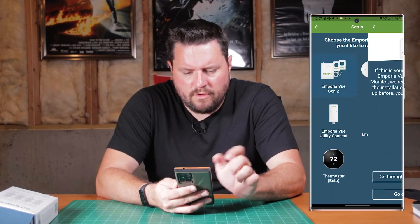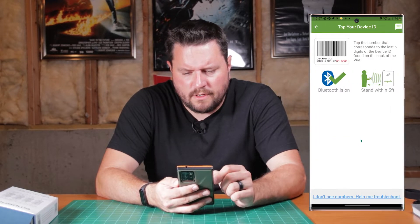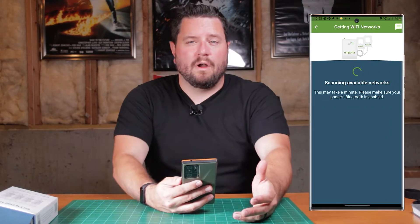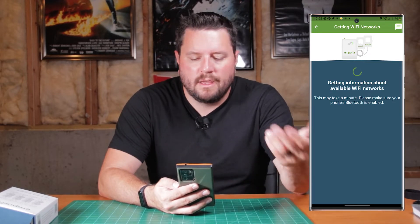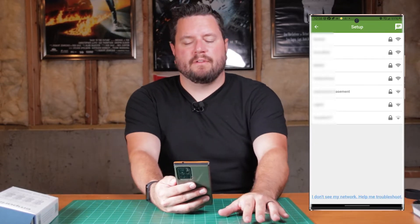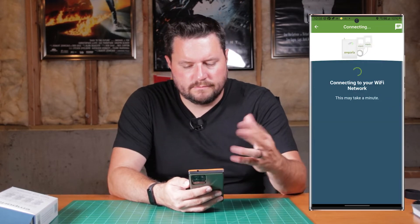I do not have solar generation, unfortunately. Bluetooth is on and I'm within about 10 feet. There it is. Now it's going to connect to it over Wi-Fi and do the typical self-contained Wi-Fi access point setup on our internal Wi-Fi here in the house. We've got to select — remember this is 2.4 GHz only, so you can't select a 5-gigahertz network. I've got my network details in here, let it connect.